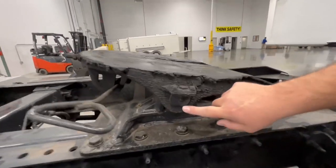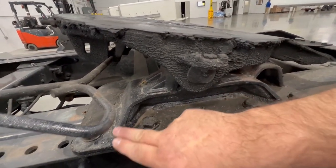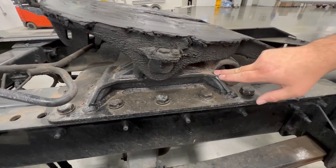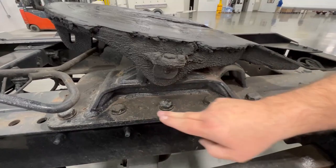This is your safety pin, pivot pin — make sure it's present. This whole assembly is your fifth wheel mounting platform — properly mounted, secured, not cracked, bent, or broken, and your mounting nuts are all present.